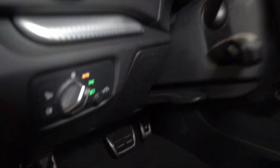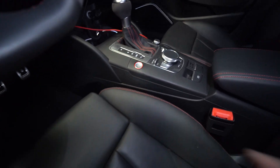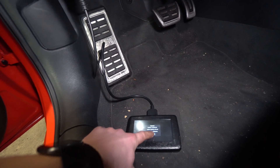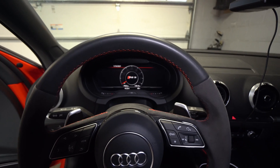The car will throw a bunch of codes through this process. Once it's done writing you get the message: writing completed. Switch ignition off and disconnect MyTuner. I always do that - bada bing, say okay, disconnect. And all things went well.